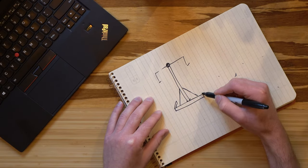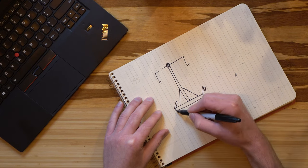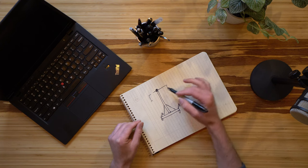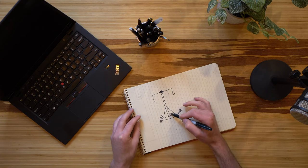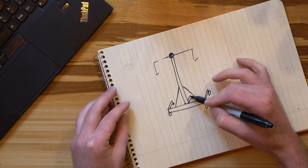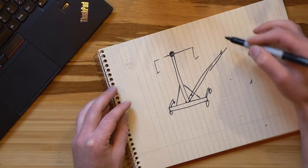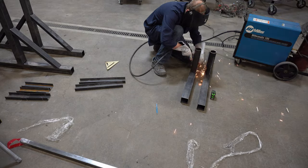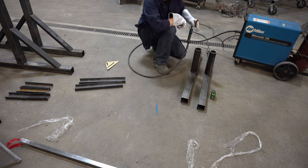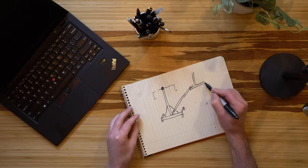And then off of that, there's another T shape, some drop downs and some perches, which of course are dimensionally specific to the vehicle that you're building it for. So this isn't necessarily a universal rotisserie, so definitely get some good measurements off your car before you attempt it. And then to link the two sides together, there's another piece of pipe welded perpendicular to the ones that go at the top of the rotisserie to pivot the car on, that I'm welding there. But on the bottom, there's a long piece of tube that links the two sides of the rotisserie together. And that helps give the whole rotisserie definitely some more torsional rigidity.